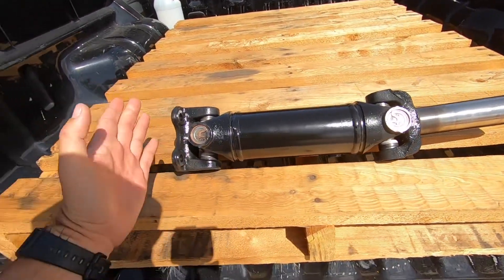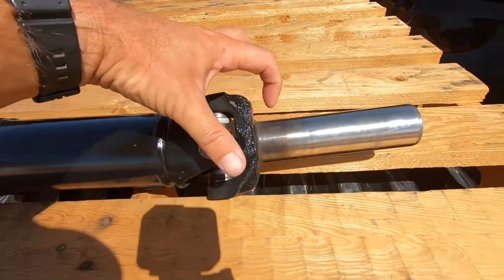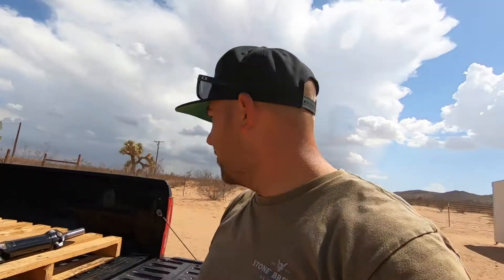The measurement is from the end of the flange to this part of the yoke — that should be about 13.5 inches, which matches the diagram in the manual. Probably not on this video, but on the next video you'll hopefully see when I install the engine and drivetrain whether that works or not. When I look at it, the one available online looks about the same.